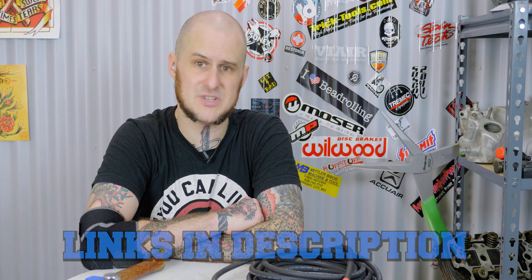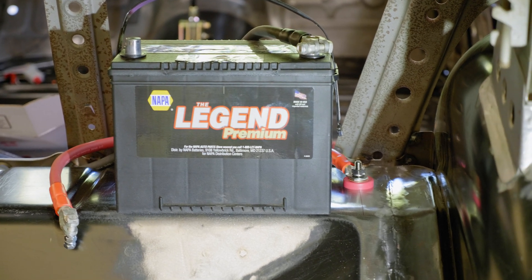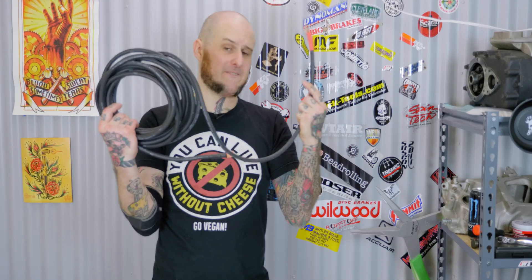There are links in the description for the battery solder slugs, cable ends, and these tools. When it comes to terminal ends, I do the same thing as with eyelets except I don't crimp them — I usually get the cast design ones, which seem stronger and last longer, and you can even get them with solder already in there so you don't need a battery slug. Because of the cast design, I don't hammer on them; I just solder and heat shrink those together. The best tip I can give is to actually mock up the cables on the car. It can be a pain working with 25 feet of cable, feeding it over frame rails, exhaust, and around things, but you end up with a much cleaner result. I also try to leave a service loop — a little extra cable — for wiggle room.